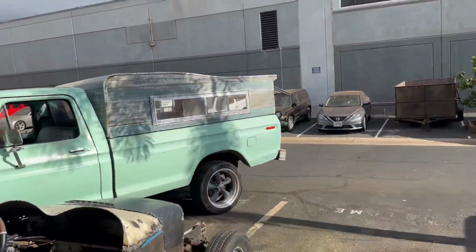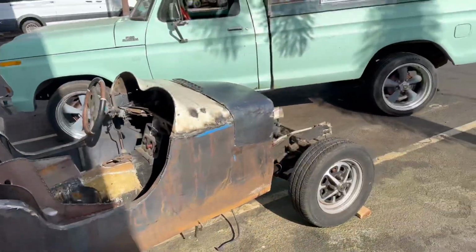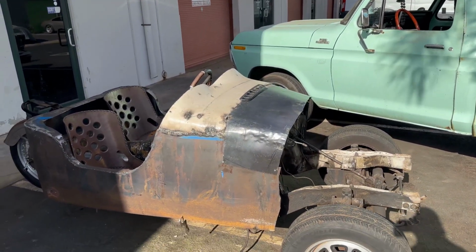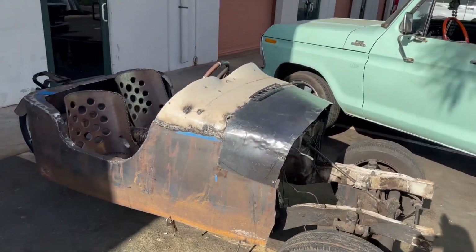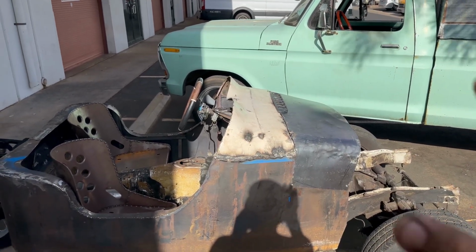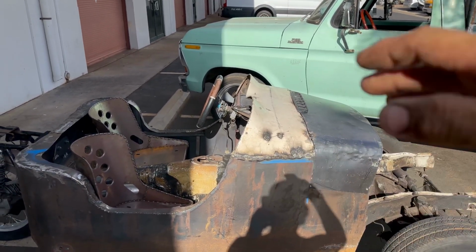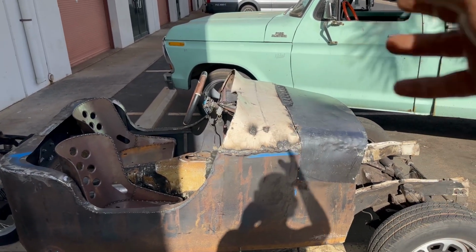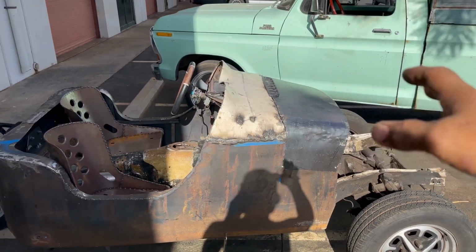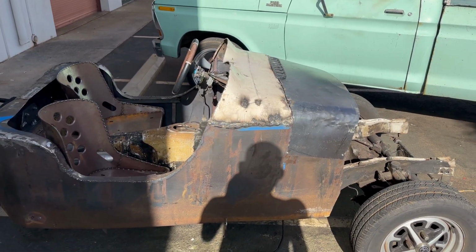All right, well, today we got the back wheel on, the spoked wheel. Looks much better. We added, roughed in anyway, a piece of sheet metal to the front. My phone died. Anyway, I was explaining how I was going to finish attaching this piece to this piece. The fiberglass with the strands in it, tack it really nicely all the way down the best I can, and then fiberglass it to it. I was going to have this be able to come off or go up and down with the hood flaps, but I decided it's not really worth it.